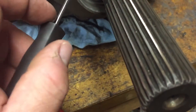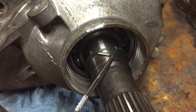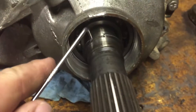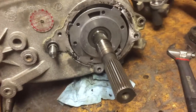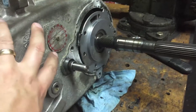I used some cheap Harbor Freight snap ring tools. One little trick I did was get right behind it with a pick and put pressure on it — I went in from this way when it was all the way back, went in there, pulled out a little bit, took the tool and opened it up, then walked it around until I could get it out to right here. With all bolts out, we should be able to just slide this casing off. It's not the way I wanted to take it apart — I wanted to split it and have the majority stay with this side.